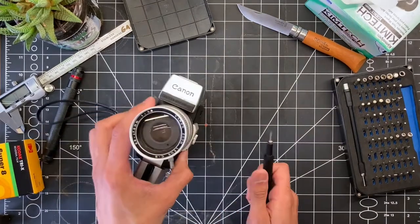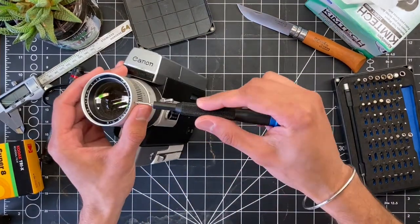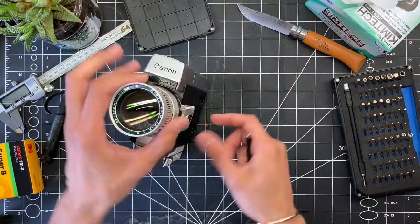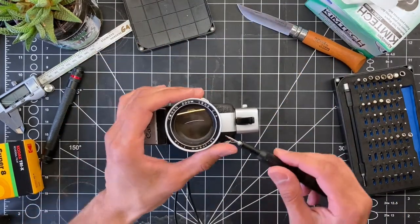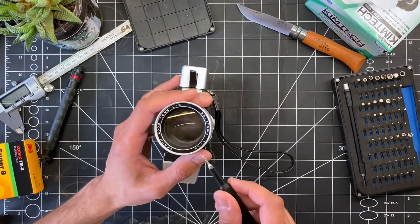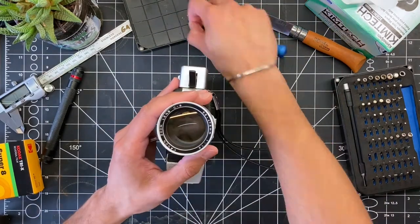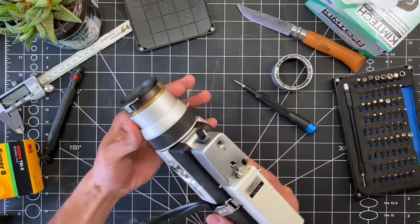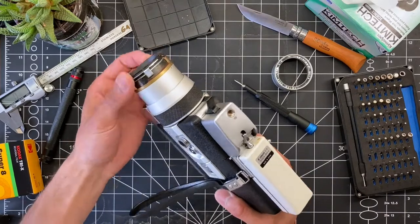So what we're going to do today is take this lens apart and clean out all of this debris. Looking at the circumference of the focusing lens, I noticed there were three small grub screws, so I grabbed my iFixit kit and simply removed them. I wasn't sure if this is how you get the lens apart, but it was a good starting point. With those off, the lens cap came off pretty easily and you could see the focusing ring.